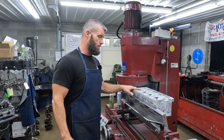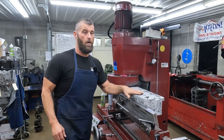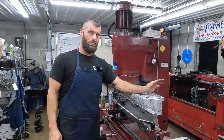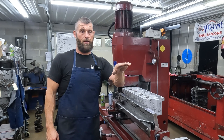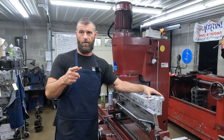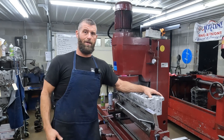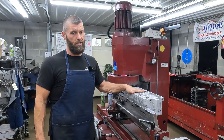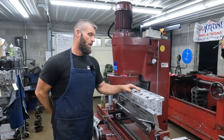Andrew has touched up the seats on this head and got it mounted in the surfacer and indicated in. He's going to touch the seats up — the seats are in really good condition, the 45s look great. He's just going to grind all the 45s, just touch them up. They don't take nothing. We're going to grind the valves — the valves are in the tumbler. As soon as he gets them out he can grind all the valves, and then we're going to surface them. It's just a 100% stock refresh, so it's going to get the factory springs and all of that.